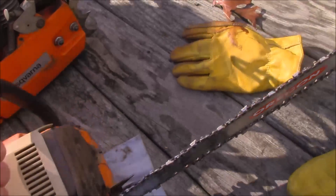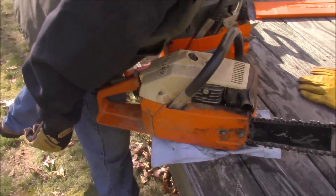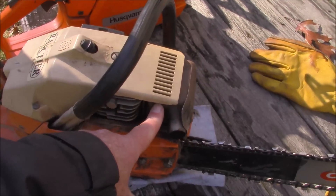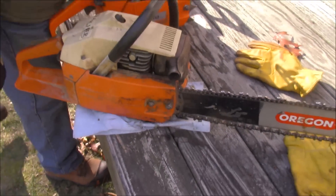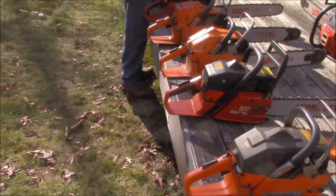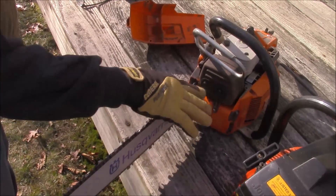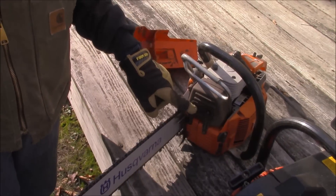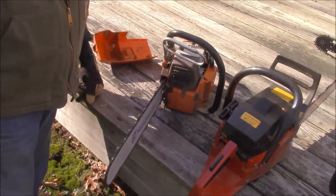What I had to do was: those bolts have a different diameter — the 272 had larger bolts, the diameter was different. So I had to cut a couple of little pipes to build spacers so that when I cinched up on the outside of the muffler it didn't crush the muffler, because the sheet metal tubes that came in there were too small. I didn't have any problem with this one — this is the stock 266 muffler, and the studs on the other end are the right diameter and thread to go into the 266 cylinder.